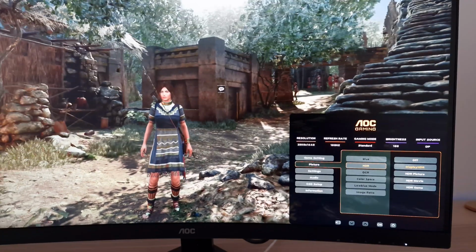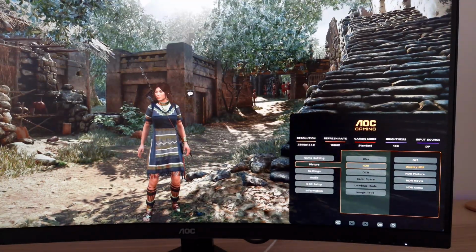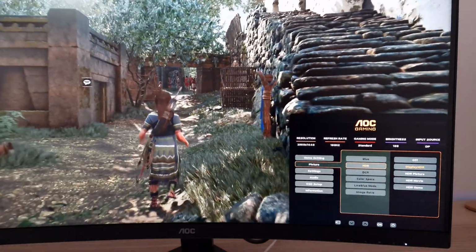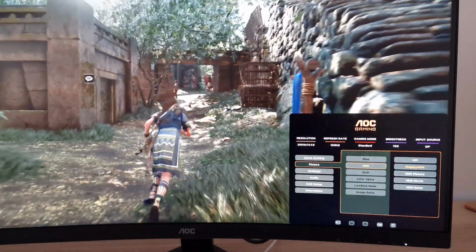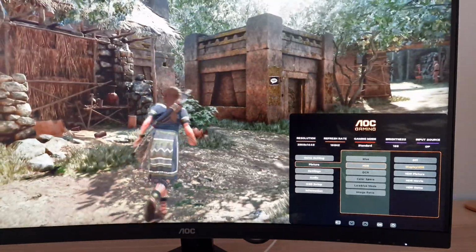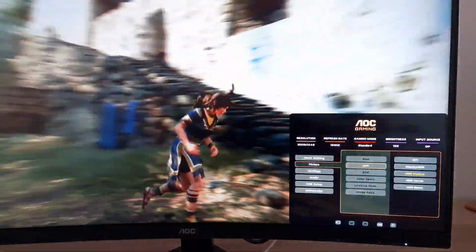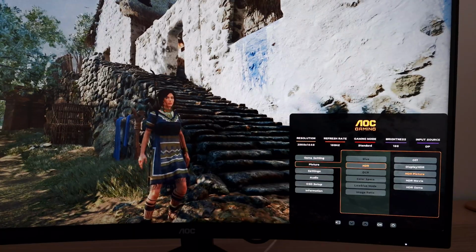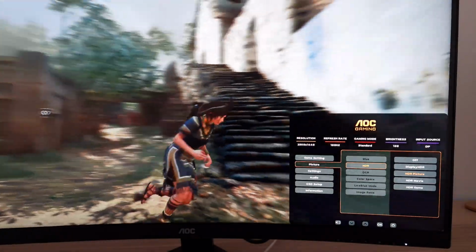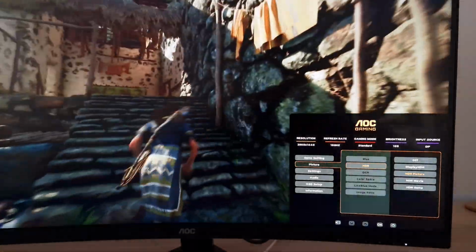When you use the default setting, display HDR, things are noticeably washed out. There's obvious undersaturation, and things really look like you're using SDR, but you're using a gamma setting which gives really low gamma, so things just look really washed out, and also it looks like you've restricted the colour gamut too much. Things have improved a bit using HDR picture, but there's now sort of a strange mixture of some oversaturated elements with some undersaturated elements, and there's still this generally foggy look as if the gamma's too low. So because this is HDR, it would technically be as if the PQ EOTF tracking is completely off.